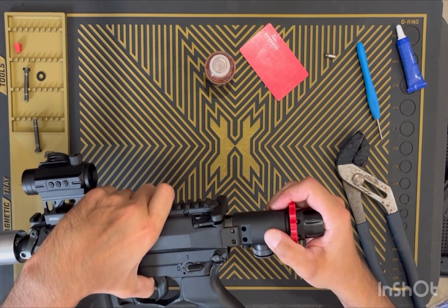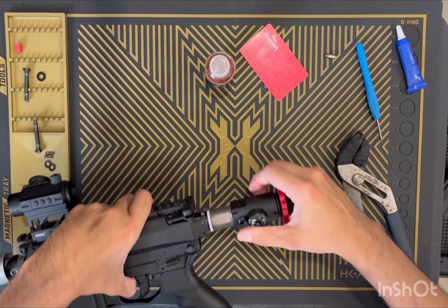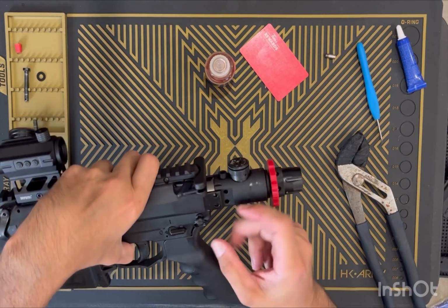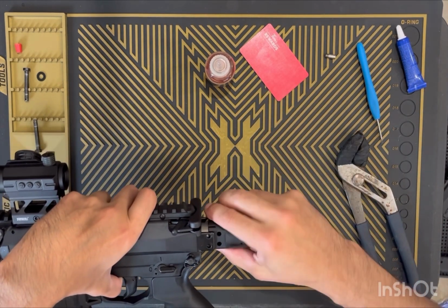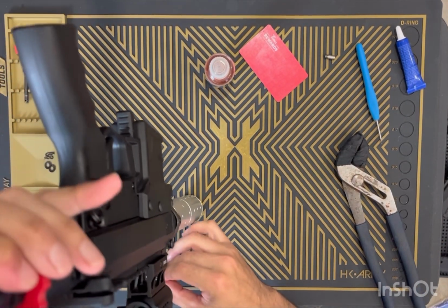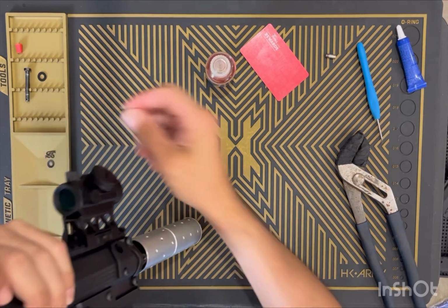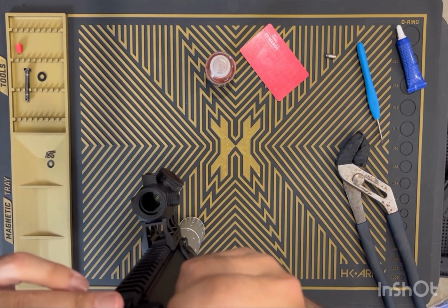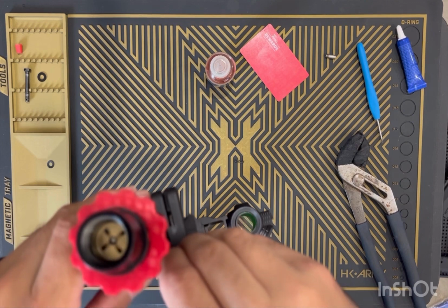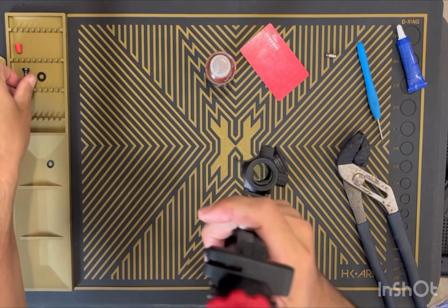Regulator back in. And actually, little known fact, you can run your regulator upside down. Just for some of you guys out there. It's not as aesthetically pleasing, and if you have a BRH, clearly you cannot pull it back if you ran your regulator upside down, but it works. Put a little downward pressure on it. Put one pin through. I usually just do one at a time. Sometimes I get greedy, and some days I'm good and that works, but whatever. Once you get one in, then it's hands-free. You don't have to worry about nothing. Slap your other pin in.